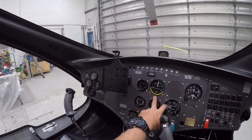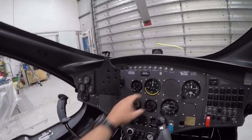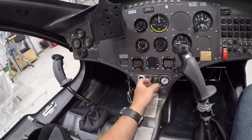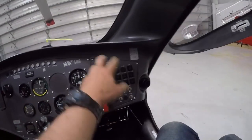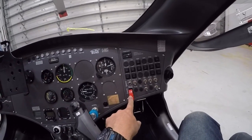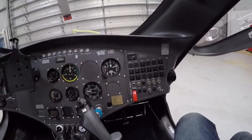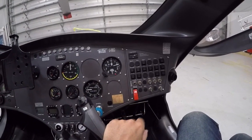The instrumentation includes outside air temperature, radio, transponder, a traffic awareness system, rotor RPM, engine RPM, airspeed indicator — note the 120 mph VNE marked on the ASI — and vertical speed indicator and altimeter. There's the rotor flight brake and pressure gauge. Instead of magneto switches, we have Lane A and Lane B, reflecting the Rotax 915. Also 915-specific is the emergency battery power switch: because the 915 relies on an ECU, if you lose electrical power the ECU fails and the engine stops, so this provides emergency power to keep the ECU running.